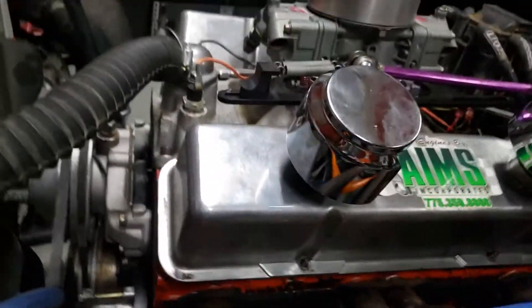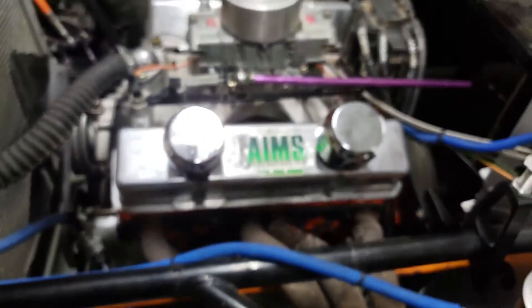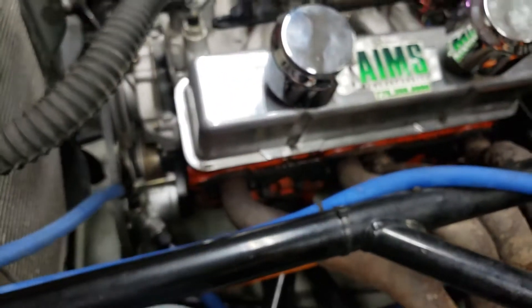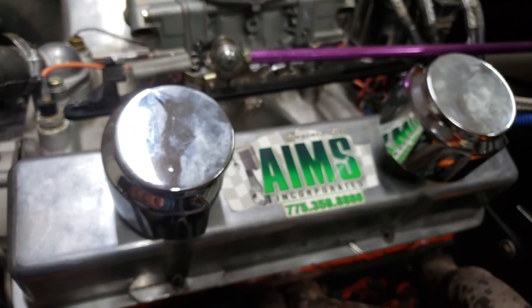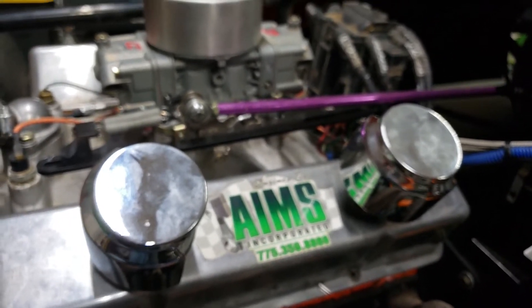So in my previous video, I had already taken out my spark plugs and disconnected the wires. When I was spinning around doing stuff for the fuel, it just made it much easier to spin it with no compression resistance. And that is also how I make sure there's nothing left inside the cylinders getting all gunky. Doing that helps a lot.